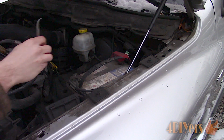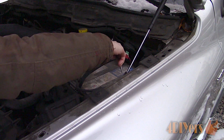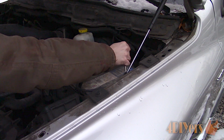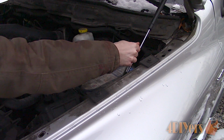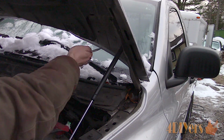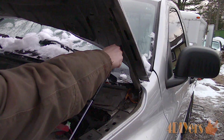First, remove the old strut. If there is already an issue with the hood staying up, it'll be worse once one strut is disconnected. Using a standard screwdriver or a pry tool, disconnect the clips by pulling them out. Make sure they don't snap into place again. Do the same for the opposite side too. It doesn't matter which end you start with first.